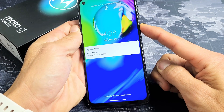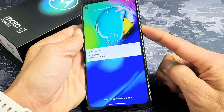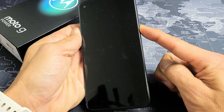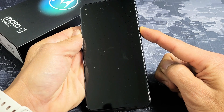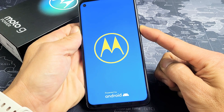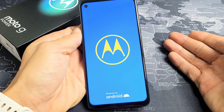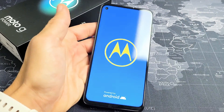Press and hold. Pretend my phone is totally black — I have no idea what's going on. I'm just holding on to this power button. This typically takes maybe like 15 seconds, so I'm still holding on the power button, just waiting for the Motorola logo to appear. Go ahead and let go and hopefully you are back up and running. If you're not, we're going to go to the next possible solution.